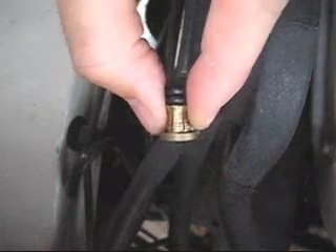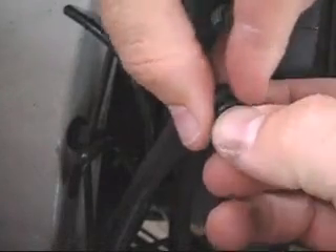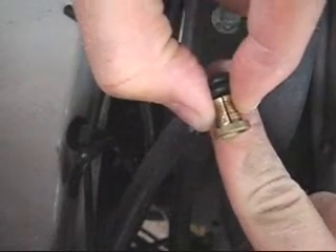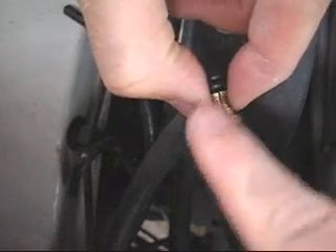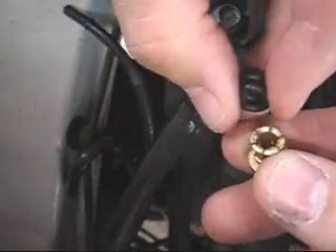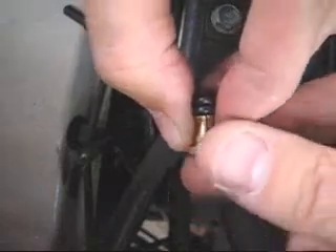Let's talk about how the high pressure line actually seals inside the top of the air spring. You have these two O-rings that sit on top of the air spring, and then the brass collet sits on top of that. The pipe goes in through here and all the way down, seating inside these O-rings. The junction between the O-rings and the pipe is what holds the pressure, so you need to make sure the O-rings are in good nick — not dirty, scratched, damaged, or cracked. Make sure the pipe is also in good shape. You can purchase brand new O-rings, airlines, and brass collets through Dennis at Rover Renovations.